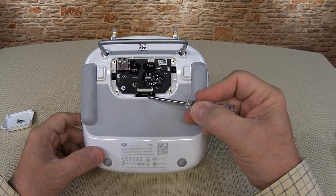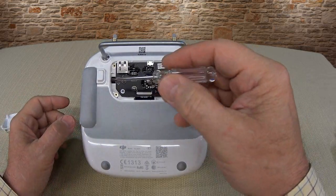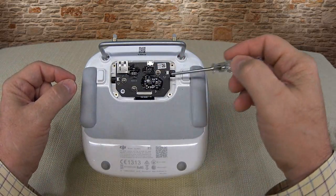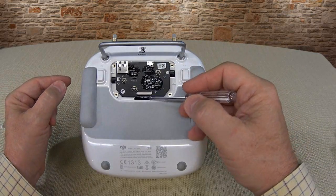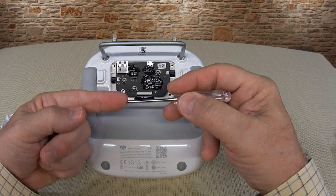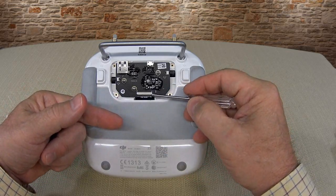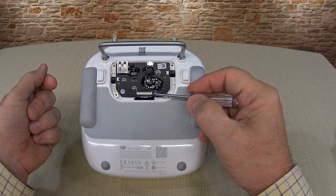If you look closely at this, I go with the big connector first. So when I put this back in, I typically do this one first, and then I'll move on because I'm a righty. I'll go to this one next because that's a little easier to get on. Then once those 2 are tight, I'll put the 3rd one on and click it in. What you want to check before you close this thing up, obviously, is that they're fully seated. And the way you can tell you've got it in there great is this has got a line across the bottom of it. You want that line to be perfectly parallel with the white connector. If it's a little skewed like this, you may have connections here and not have connections over there. So if you look at it closely, that white line is exactly parallel with that connector, so I know that's fully seated.